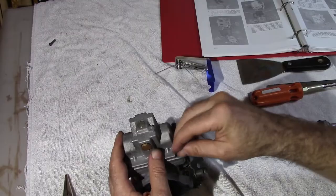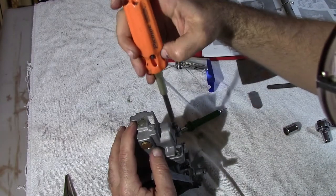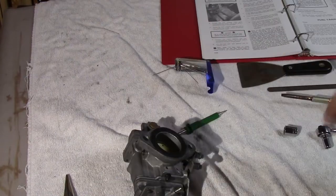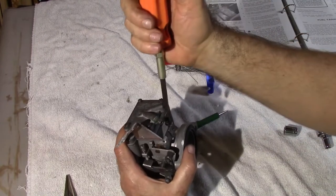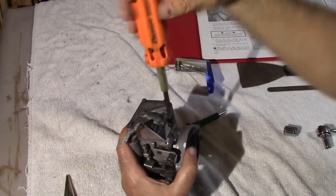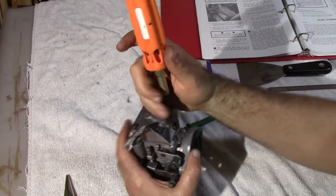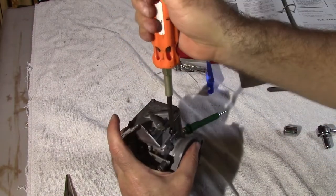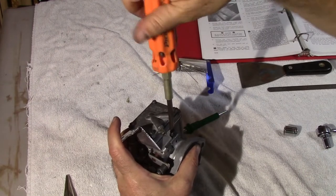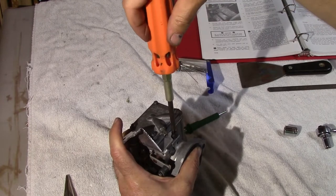And that's it folks — just tighten up the screws. One more thing: according to the book, we're going to adjust this air screw here. We want to have it fully closed as you turn clockwise — there we go, it's seated. And the air screw, you want to make it one and three-quarter turns: there's half, there's one, there's half, there's three-quarters.